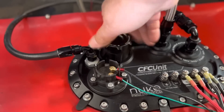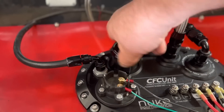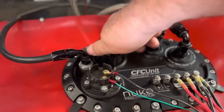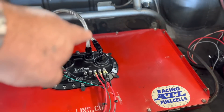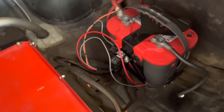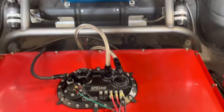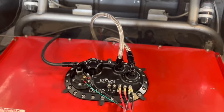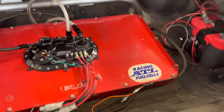It has a fill cap right here, O-ring sealed, with a rollover valve inside. That's a vent on the left, a return line — I want to put a 90 on that — and that's the pressure side out. I also installed a couple more relays mounted on the side of the battery. I've got to hook up one power supply and one trigger so that when this thing starts seeing more boost and needs more fuel, the ECU will turn on the second fuel pump.